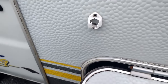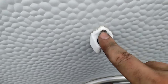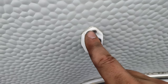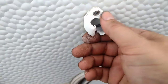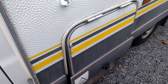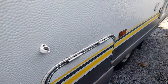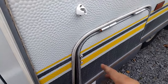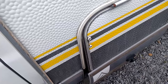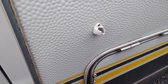And the plan is to just remove these and use rivets. Use glue on the hole and an aluminium rivet here. So the glue is coming out and then I'm just smoothing the edges and sanding the rivet a little bit down and painting this white, because it's a little bit weird looking when all the hatches have something like this. We need to basically get a new one here and the other side. I think it's missing even the whole damn upper piece. So aluminium rivets and glue, so it's not leaking anything inside.